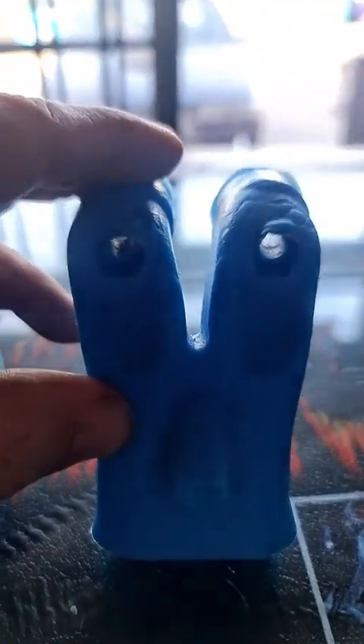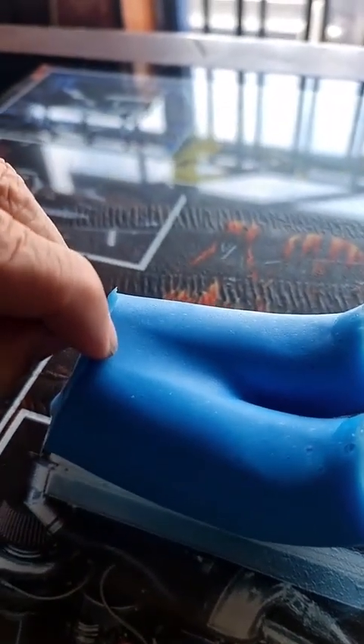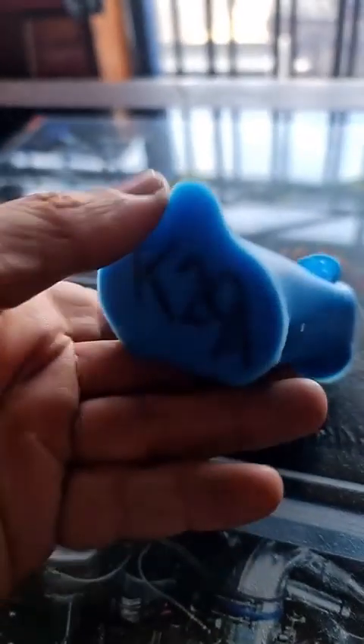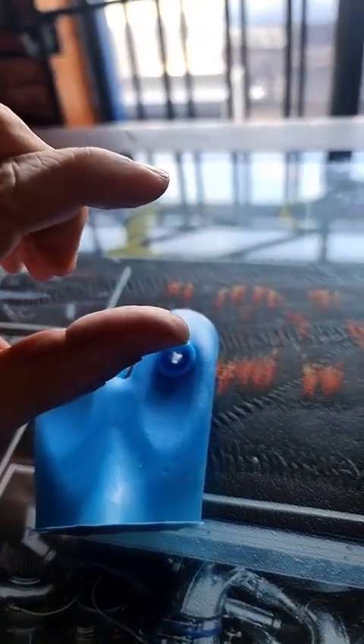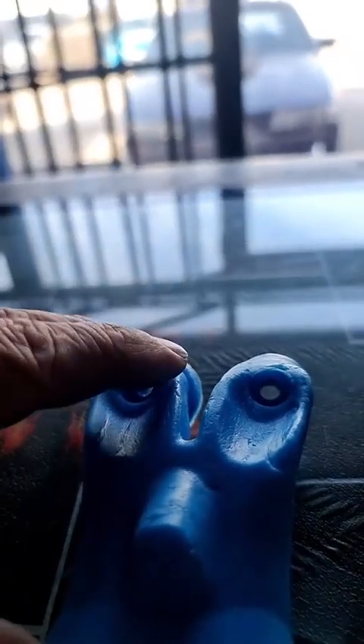The divider is almost vertical straight through there, so this is a massive dead area here, and vice versa on the floor - another dead area. Where the Honda, as you can see, they've tried to roll it and put a little C-shape into it - it's obviously too wide for me but the basic principle is there. You can even see in the port they've already started from way back here, telling the air it's going to have to start separating. They've lifted the floor up and reduced the cross-section to try and part the air for the divider. With the 4AGE they haven't done that, so the air is just going to come in and collide with that wall, bank on it, and cause the air to separate.